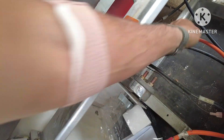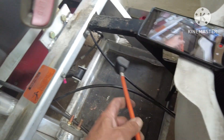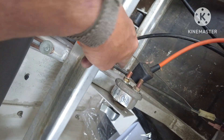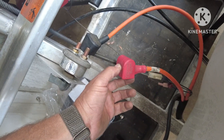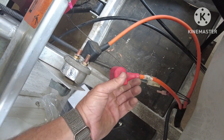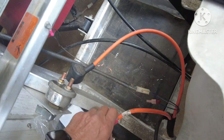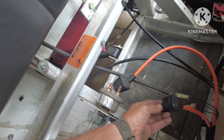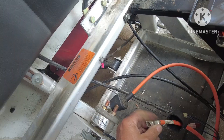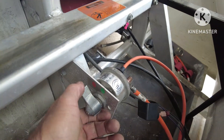We've cleared the cables off. This is the negative cable from the controller that used to go to the battery position over here. We're going to attach this cable to this side of the post facing the rear. Don't let the red fool you, because this was just a series connection - but this cable terminates into the hood with a black rubber cover. You should take a continuity test to make sure you're handling the right cable. To eliminate confusion, I'm going to remove this red jacket and repurpose the black rubber terminal cover so the cable's color matches up.